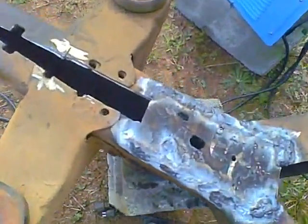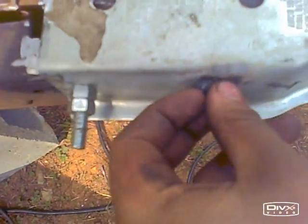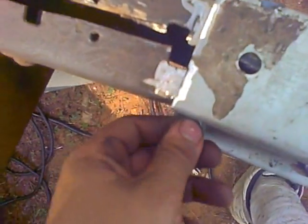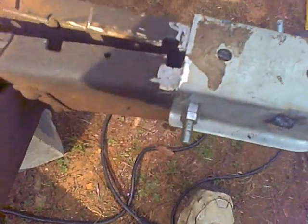I wonder if I can get a rod down there between those two pieces of metal, but I can't grind it. I might try to weld in there, but I don't think it'll work because it's not ground enough. At least I could do it from the underside — flip the trailer over and do it. I ran two bolts through this, and this one is turning so I welded it a little bit there. I double-bolted it so it doesn't slip. Now I think I'm going to weld here, here, here, and here — fill in these holes. I think I'll put a little weld on the thread to keep the nuts from backing off, welding them together or something like that.